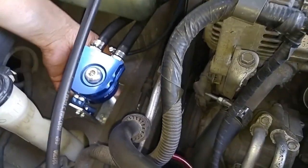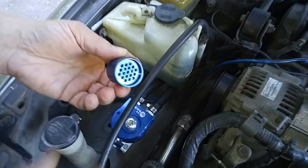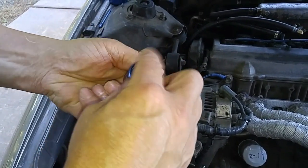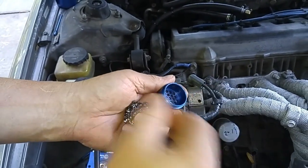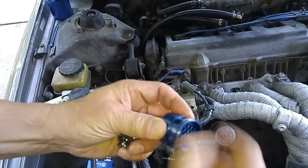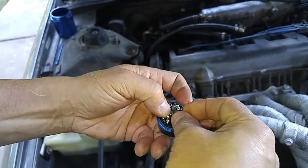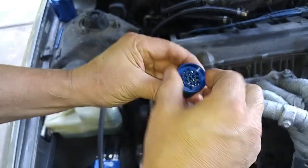There's one other thing I added to this kit: the filter screen for the blow-by gases. It's two-piece and allows you to put in filter media — I just used some stainless steel Brillo pad material. Normally the gases would come in through the top and work their way to the bottom part of this ring, with virtually no filter media except for the holes. So I took this stainless steel material and used it as a filter to capture the oil in the vapors, then screwed that into the base of the catch can.